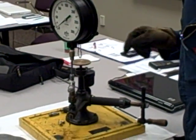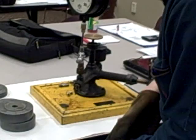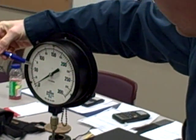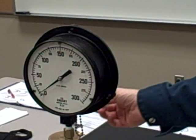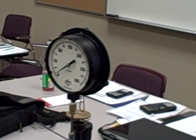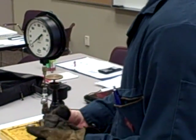Right here, that piston actually has some weight, and there's a number 5 stamped into it. On this particular tester, that number 5 means 5 psi, so it should be registering 5 psi. Each division on the gauge is worth 5 psi — so here we have 50, 55, 60, 65, 70, 75. Each minor division is 5 psi. Right now I have ideally 5 psi, and it looks like we're almost up to 10 psi. But I don't expect this gauge to be terribly accurate down towards the bottom. I expect to see better accuracy as I apply more pressure further along the range of the gauge.